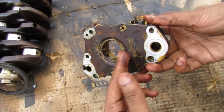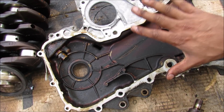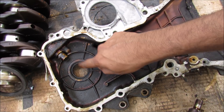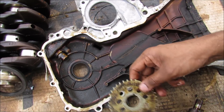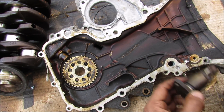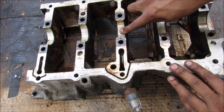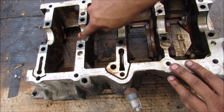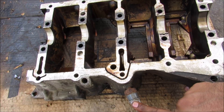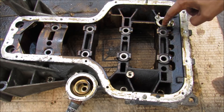This here is the oil pump removed from the engine. We've got the inlet here and the outlet over on this side, and it's driven by the crankshaft of the engine. The timing belt cover pretty much seals the front half of the engine. Over here we've got the crank seal, and the crankshaft sensor which will read off of this little gear here that's spun off by the crankshaft. Over here we have a little hole that will feed oil to the timing chain tensioner. This is the crankcase — it's just a piece of cast aluminum. These are the spots here where the crankshaft will ride up against the main bearings, and you can see we've got some oil passages that go to the oil filter. This is the oil pressure sensor, and on the bottom here we've got the inlet for the pickup tube where the oil pump will draw oil from the sump.